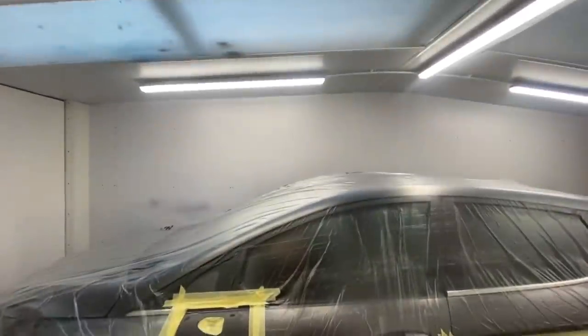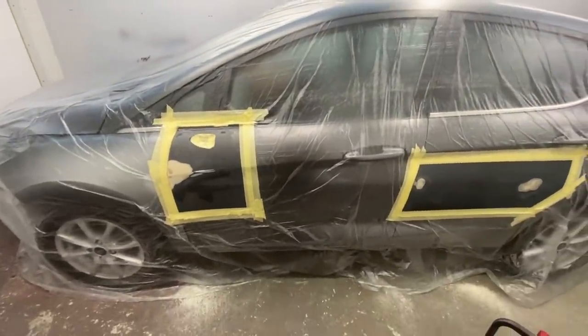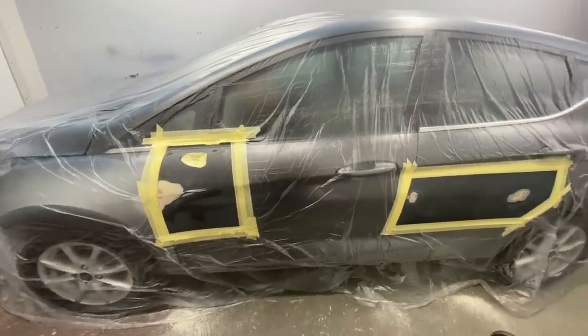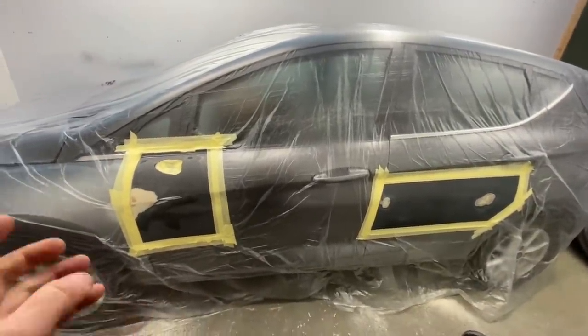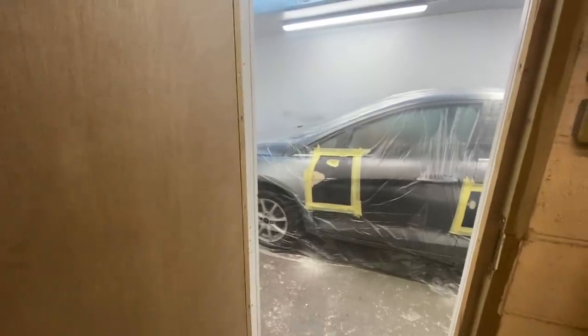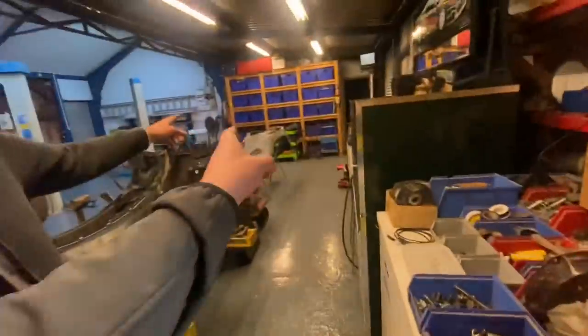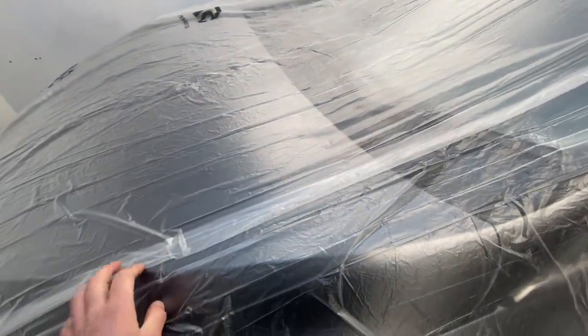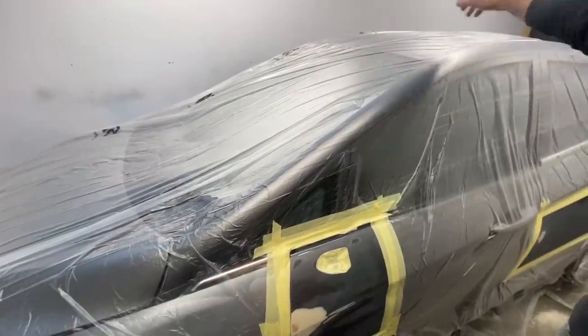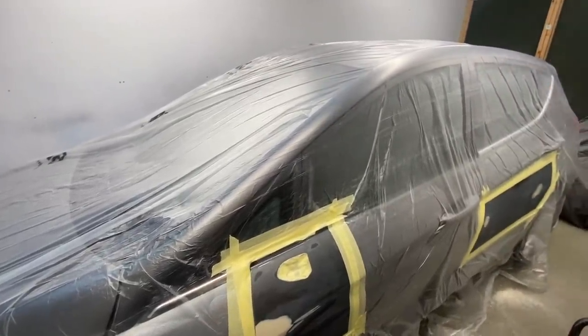There may be a little bit of flickering because Chris has got LED lights in the paint booth. The hard work is properly done this time. Both those repairs are perfect — you can feel them. He rubbed them down, put a little bit of stopper in there, flattened it off, and it's all bagged up and masked up. Chris is just going to knock up a small amount of primer to do those patches — once it flashes off he can unmask and move to the bumper. He also needs to take the bonnet off as it has a lot of imperfections and muck in it. Also, a few people mentioned the masking paper roll was inside out — it was half price because it was wound on the wrong way — but it doesn't matter, it's only primer.